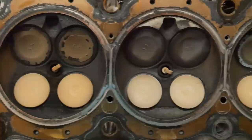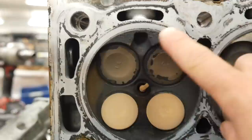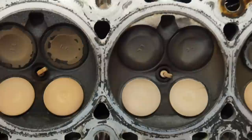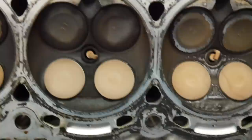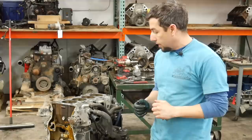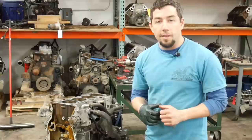Looking at the cylinder head, the center two cylinders have marks on the combustion chamber. Pulling the head gasket off, you can see the carbon pattern — some cylinders are dirty with carbon, which is kind of normal, and some are clean. There are actually some pock marks from debris. I don't really know why the pistons hit the cylinder head, but I'm going to venture to say it's lack of bearing, and that's probably from lack of oil. Now we're going to flip this engine upside down, pull the oil pan, and show you the counterbalance cartridge, the crappy pickup, and how bad that crank really is.